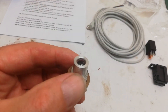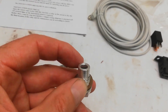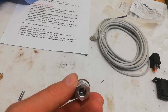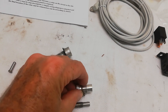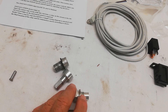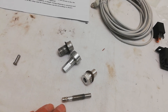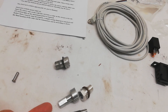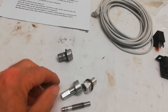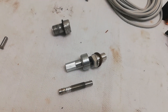There is an oil seal - a fawn leather-coloured oil seal inside the adapter - and that's what stops it leaking. What I'm going to do is put threadlock on this thread, having cleaned up all the threads in the gearbox, to make sure it doesn't leak oil past the threads. Then I can put a 10mm spanner on it - you can't get a socket on it because the frame and exhaust are in the way - to tighten the adapter up.